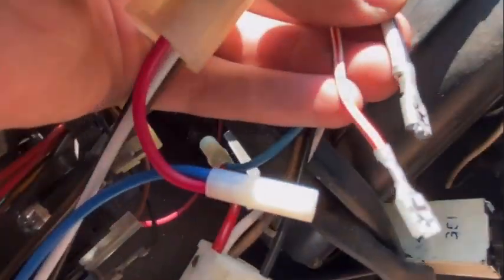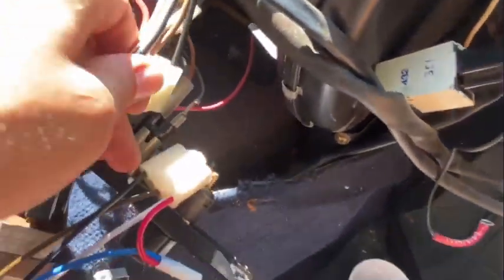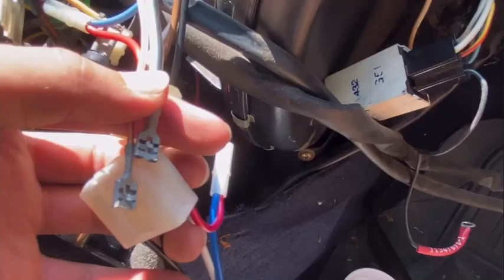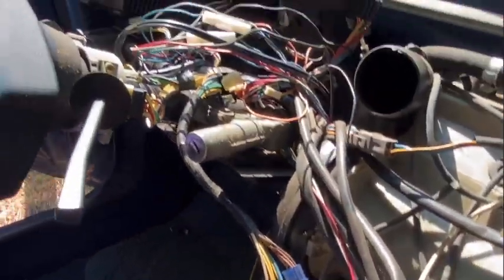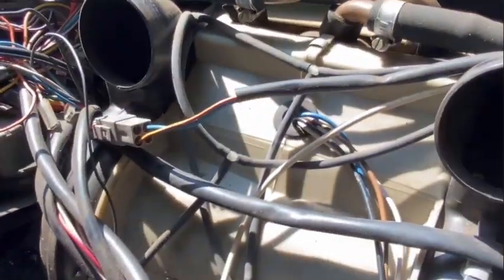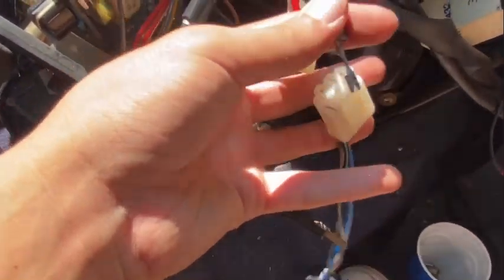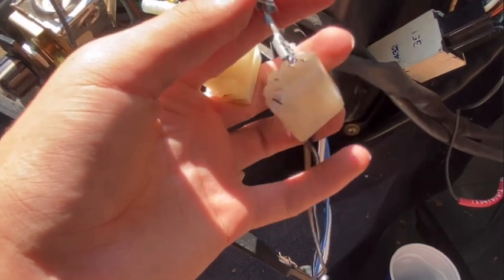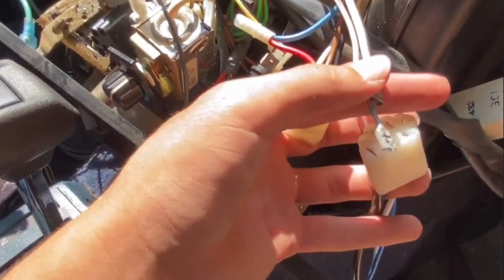There's a red and a white one, and a black and a white one. So what you want to do is you want to yank these two out of your old resistor, and you want to plug them into your new resistor. Now the reason I'm plugging these into my new resistor before I take out the old one is just so I don't lose these two wires. There's a lot of wiring going on over here, and some of it I've actually tucked up there that's supposed to be right here. But I'm plugging it in right now just so that way I don't lose these two wires moving forward, because that is going to not be a fun time. So yeah, I'm gonna plug these two in right now,